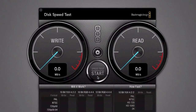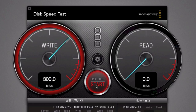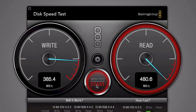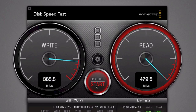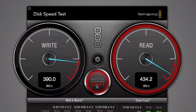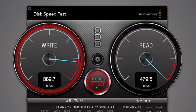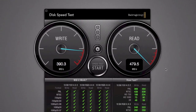The hard drive tested earlier came in at around 100MB/s read and write. Starting the test now — wow, we can see straight away the write speed is right up there at 385MB/s, and the read speed is 480MB/s. So we're looking at almost 4 times improvement over the stock hard drive. We're looking at around 390–400MB/s write and almost 500MB/s read. That's how much faster an SSD is compared to a standard hard drive.